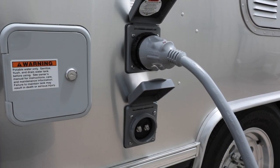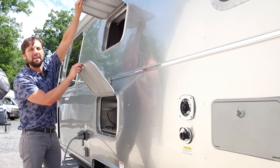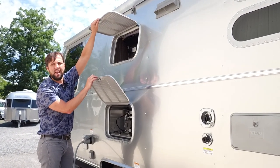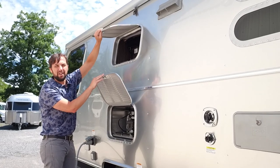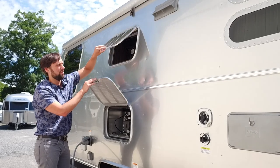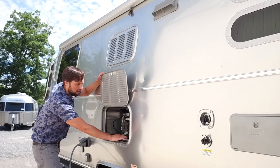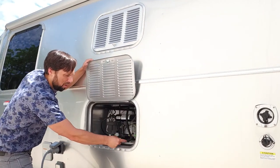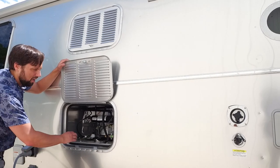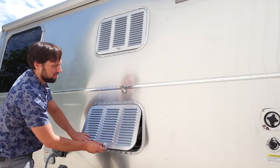There's refrigerator ventilation top and bottom with a thermostatically controlled fan. On the inside of the refrigerator there's a fan switch to manually shut it off, but I recommend leaving it on the whole time and letting the thermostat decide. There's a condensation drain with a little bug guard. I do not recommend hosing this area out or storing things in here. There are also insect screens to prevent bugs from flying inside. Keep the area clear — you need ventilation here.